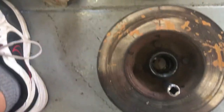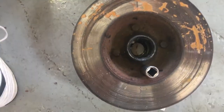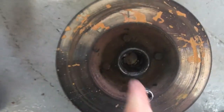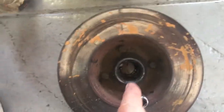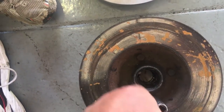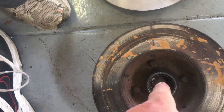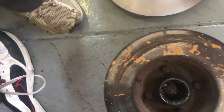With that being said, we wanted to show you what a set of brake rotors and wheel bearing assemblies look like and how you want to go after them. When you want to know whether there's a good bearing or not, you can clean the grease off. A lot of people think dirty grease means a bad bearing, but that's not the case. What you'd actually look for is little straight lines going down. Scoring in a circle does not necessarily mean the bearing or race is bad — it's when you see straight lines that the race and bearing are definitely shot.